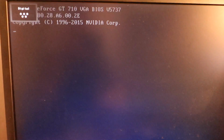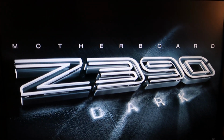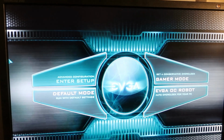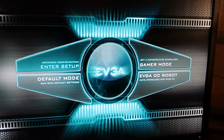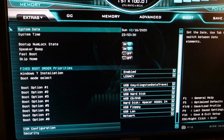Right, so a few issues. You need to have the USB stick in NTFS, at least for me, I don't know why. Well, I'm not sure, but the Rufus USB utility is actually much easier and better to use than WinSetupFromUSB. So I recommend you try that first before trying WinSetupFromUSB.